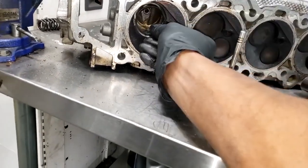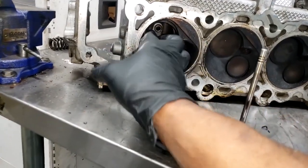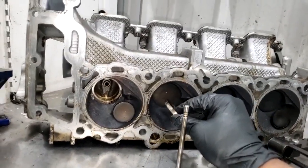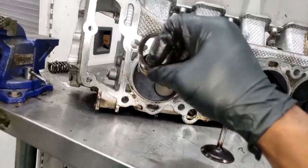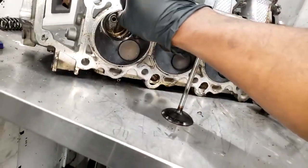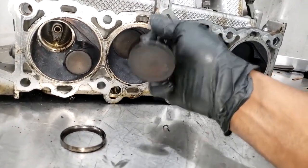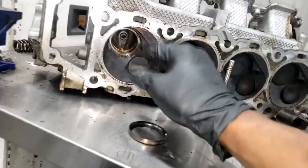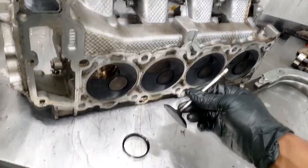But because this fell out, guys, you're almost talking catastrophic failure when this happened. I think the cylinder head got hot, expanded, retracted, expanded, retracted. This seat, it's not made of aluminum, I don't think. So it eventually will fall out. Now I don't see any bangs on the valve from a piston, so I wouldn't say the piston hit the valve. But he likely had no compression, misfire, things like that, and loud. Probably would run loud. This is on the intake side, so who knows?